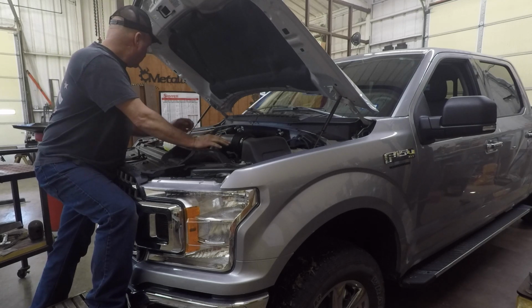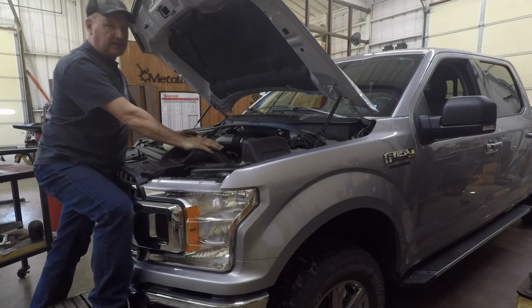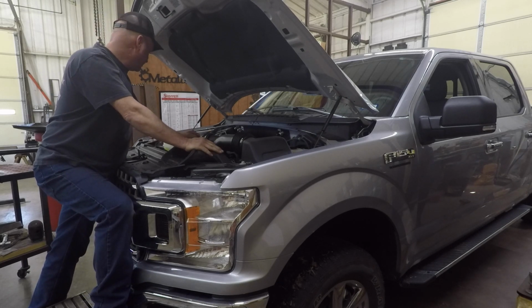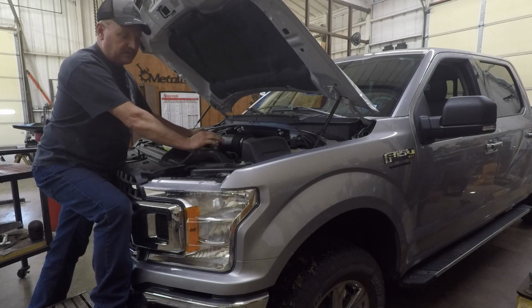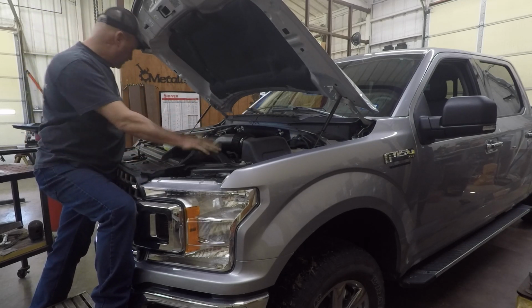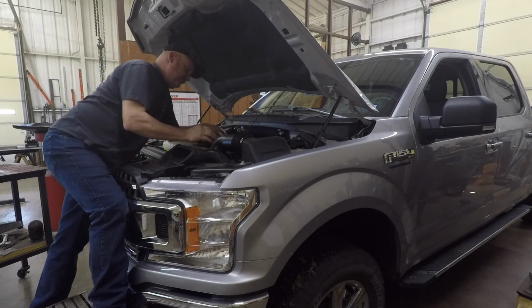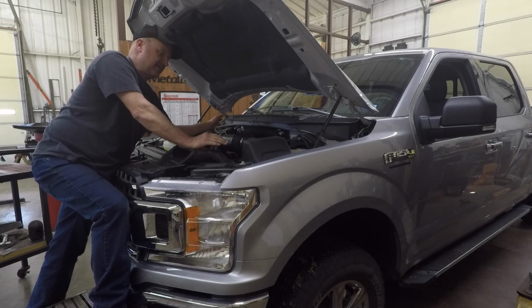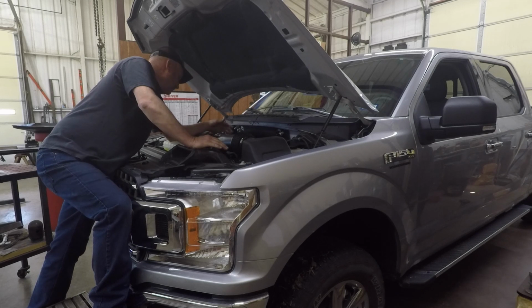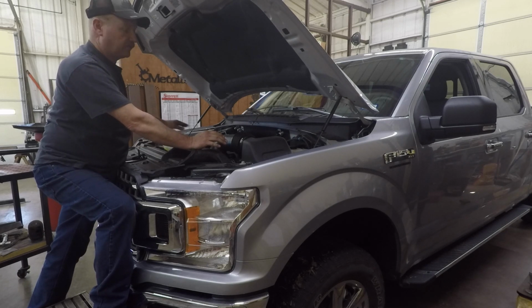And anyway, check your battery cables. I hate to tell you all this stuff. A lot of you guys know all this. I'm just telling you, this is the time you check your truck out, your wiper blades, clean the windshield, clean your truck up. When you change your oil, check everything thoroughly, your belts, your hoses. I found no sign of any kind of leak. There was no seepage, nothing on this truck anywhere. Belts look good, everything's in real good shape. And tire pressures, washer fluid.